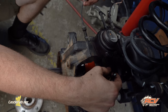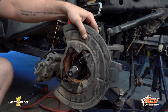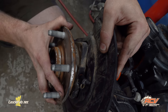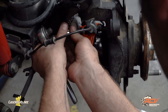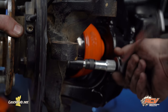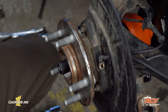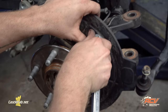Now that the RCV Performance Axle is installed, we're going to reroute the ABS line — wind it through the dust shield and install the bearing. As you're sliding the bearing on, start to set the ABS sensor into the proper hole. Use the supplied hardware from RCV and bolt the bearing back on. Now that the bearing bolts are installed, torque to spec. Now that the bearing is installed, reinstall the Allen that holds the ABS sensor into place and torque to spec.